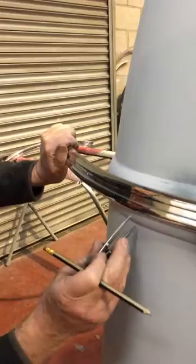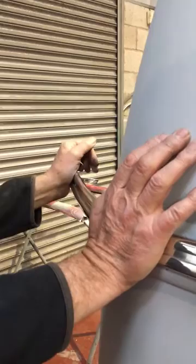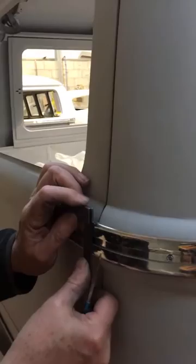You are now ready to bend the curve around the rear corner. Gently apply pressure and slowly work the trim around the corner. It is possible to apply a small pressure up or down as you go around the corner. You can also twist it as you are laying the trim on a compound curve.